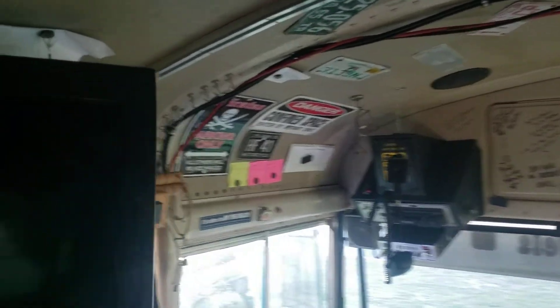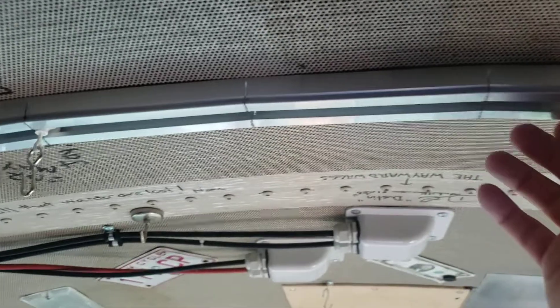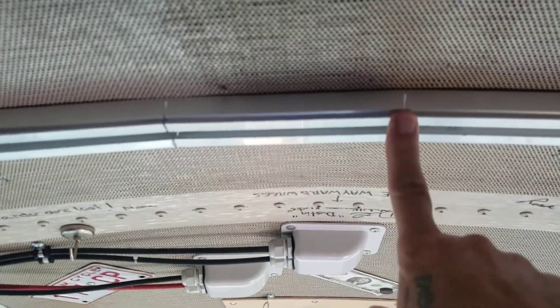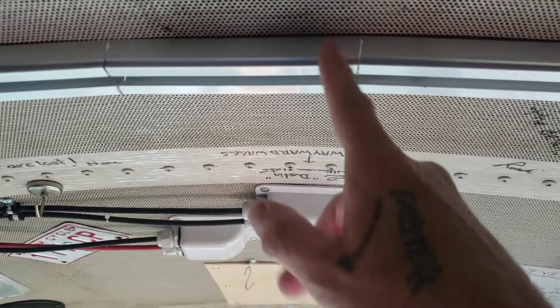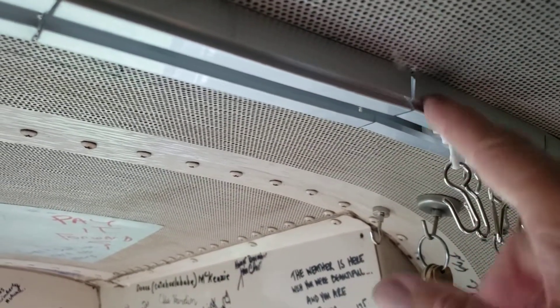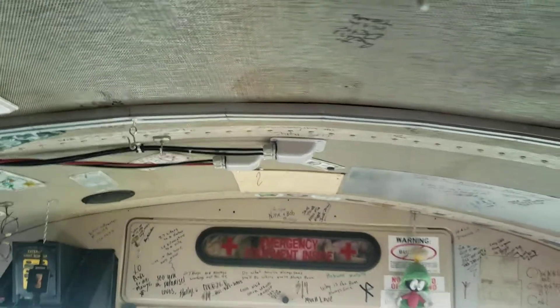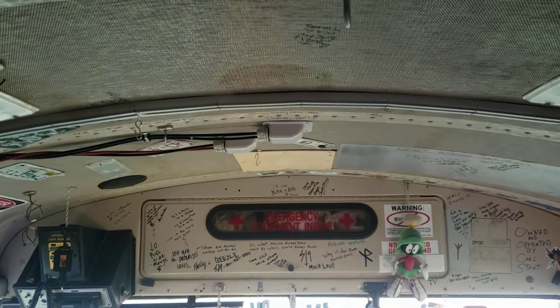Anyway, I got that track today. It wasn't cheap — by the time you get shipping and everything it was probably a hundred bucks. But it's real heavy aluminum. Of course it comes straight so it's not gonna fit around the roof, but you take a four-and-a-half inch grinder and notch these out every six inches and it ends up bending just fine to contour the roof. It was six to eight inches short right here — they send you two of them, so I just cut eight inches off the last one and screwed it in there. I think that's gonna work really well. Peace, love, and hippies.